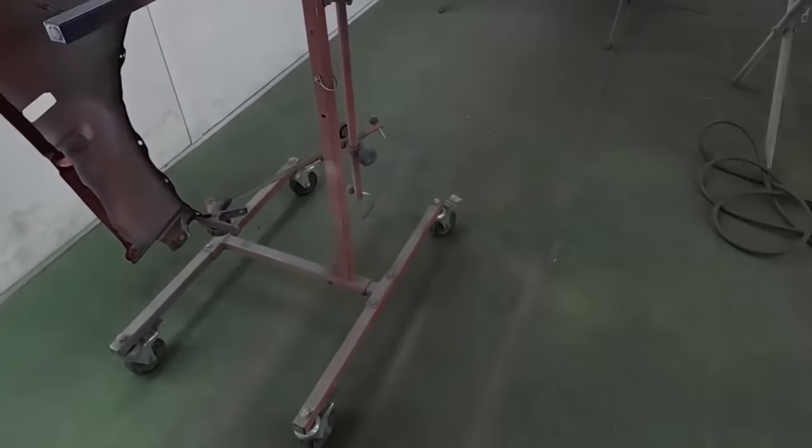And check this out, guys. It's like a bloody red. Remember, this is an OEM color. It comes on the Mazdas, so I just love that. It's translucent. I think we're going to put two coats on. Since we're doing a complete paint job, we make the rules here with the mid coat. If we were trying to match something, then we would have to do spray outs and such. But let's go ahead and get this loaded into the gun and lay down two coats, about 10 minutes in between coats.